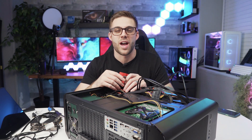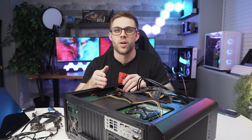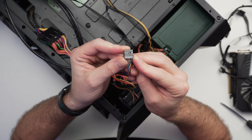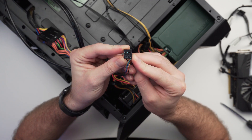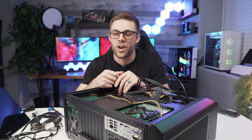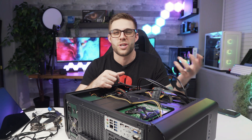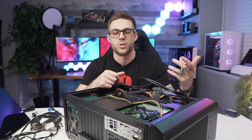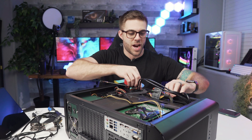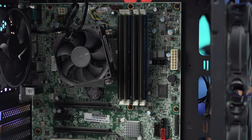One compromise I've already noticed - I don't think I can fix this because I haven't found an adapter for it. The front panel audio for the M93P uses a longer connector than most normal HD audio connectors for aftermarket cases. So the only compromise so far is we're not going to be able to use the headphone and microphone port on the front. Most people are using USB microphones now anyway, and for headphones you can plug into the back of the case or use HDMI. I'm just going to hide the connector inside the case.